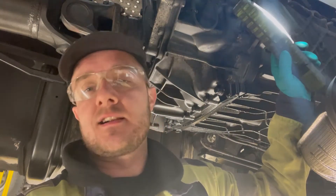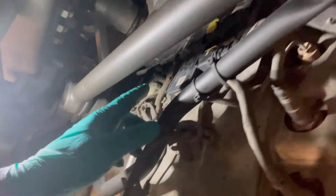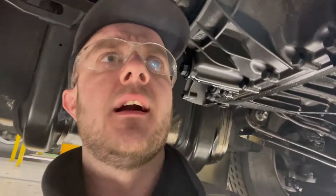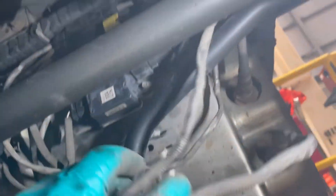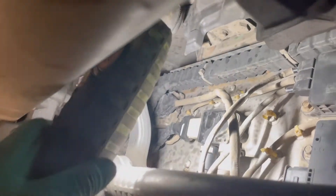This is the 6x2 tractor unit. I'm doing the NOX after and the PM sensor — these are a little bit easier because there's more access room. If we look up here, you can see the PM sensor right there and the NOX is up there in the corner. I'm going to get all these cable ties cut off; it'll give you a better idea of how it's all laid out. Now I've clipped the cable ties off — that one there is for the PM sensor, which goes to the top one, and then this wiring loom goes from the bottom all the way up to the NOX after sensor at the back.